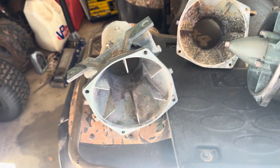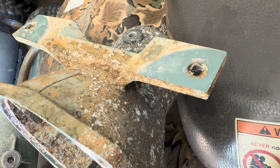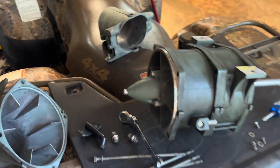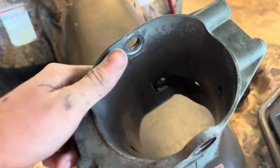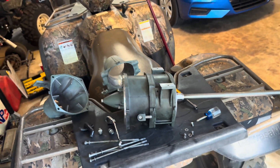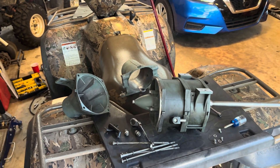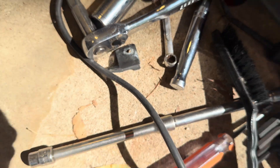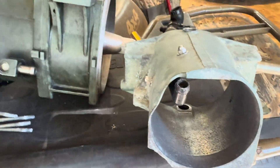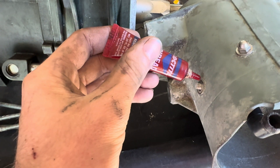Another part just came in — the rear nozzle. That's in much better condition. The old one is completely shot and has a hole inside right here. It also came with the bolts. So I went through, sanded everything, got it really smooth — not a mirror finish but much better than before. You might think I'm going a little overkill with this, but why do you port and polish a head on an engine? To make it flow better — same way with this. Every little bit helps, it's just simple physics. The less friction you have, the more energy available you have for work. And every screw I'm putting on here I'm going to put a little bit of Loctite on — keeps it tight and keeps it from rust-welding.